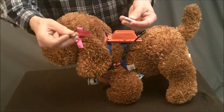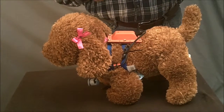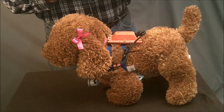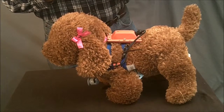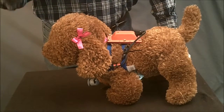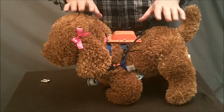So what we're going to do is go through the battery change procedure to put some batteries in there. Now I have my two batteries here. These are A23 alkaline batteries, also known as 23As. A couple of other names are the garage door opener battery V23GA, MN21, LRV08, but most of them are going to have a marking that says 23A or A23. So those are the batteries we want.